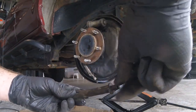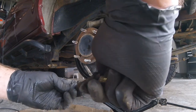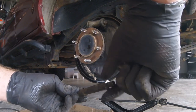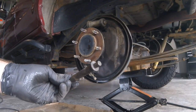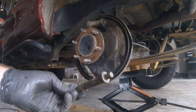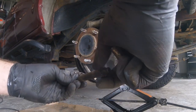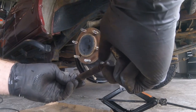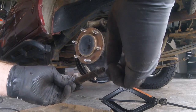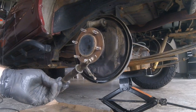Now's a good time to clean this up with Brake Clean and PB Blaster to get the threads nice and clean, and go ahead and screw it in to the maximum depth — or the shortest overall length is a better way to think of it. Now this is the rear driver side, and it's actually a reverse thread because both brake assemblies are mirror images, so the threads had to be opposite for the mechanisms to work the same. So on this one, if you turn it to the right it actually unscrews. Make it the shortest length so you have enough room to slide your drum over.